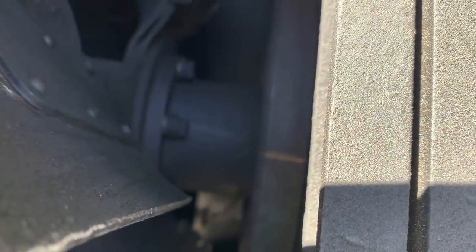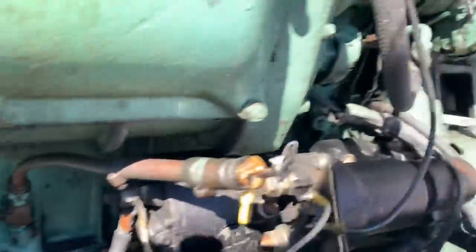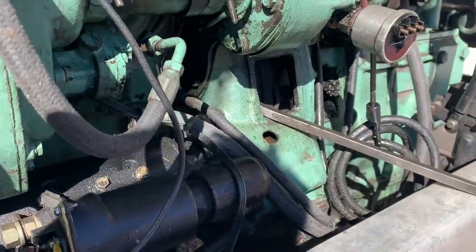So it's not just end play on the crankshaft. I suspect that it's got some loose flywheel bolts or something going on with that, so we're gonna go ahead and pull the transmission and take a look at that. We'll inspect the clutch while we're there.